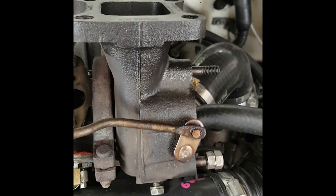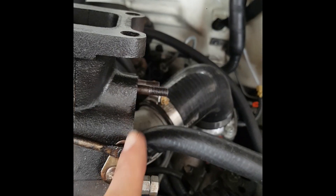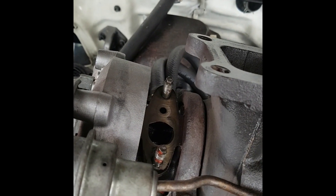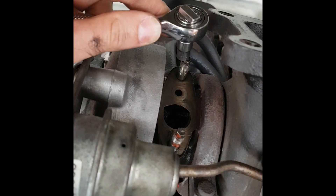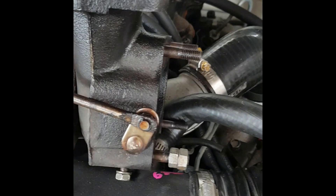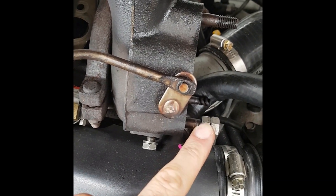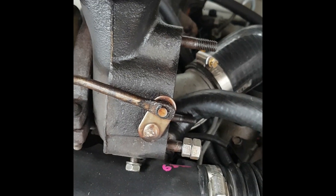The first thing you're going to have to do is pull out these studs. There's one, two, three, four of them on this side that go to the dump pipe. And then you've got two more studs here and here that attach the oil feed and drain, so you've got to pull them out too. The oil feed and drain is easy — it's an M6, so you just get a spanner and you can undo that. For these studs on the dump pipe side, just get two M8 nuts, lock them together and you should be able to get them out as well.